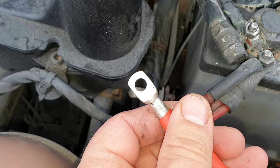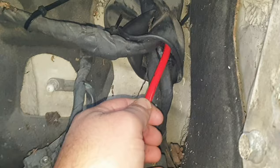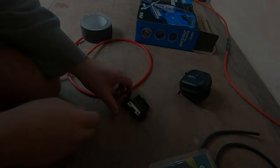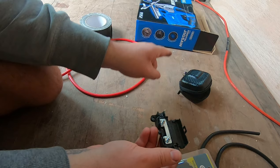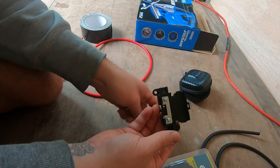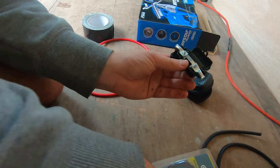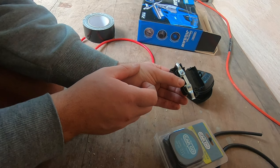That fixes onto the main battery. I'm going to add a fuse about here — that's where the first fuse is going. So I'm adding a fuse under the bonnet, from the main battery. Come up a bit, cut the cable, and the fuse sits in the side there. It attaches to one bit of the cable — crimp that to the other bit of cable, bolt it on. That's one bit fused. I'm going to go under the bonnet now and put a fuse in — I'll show you where I've done it.